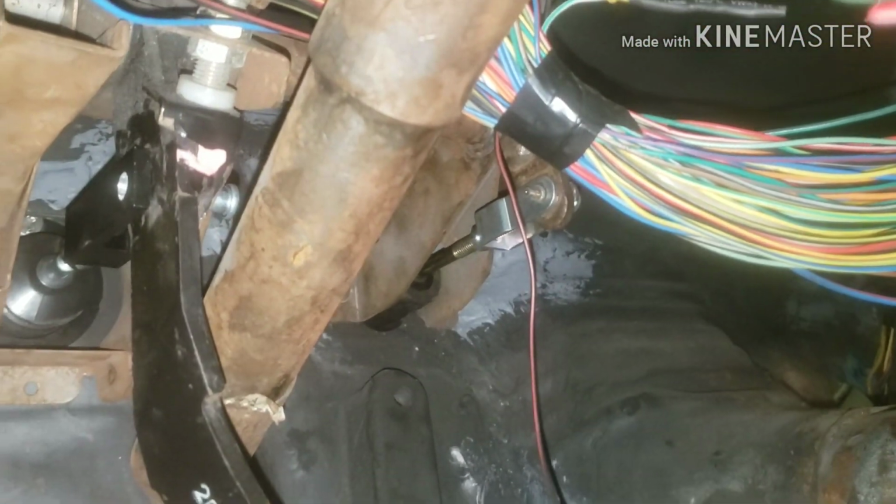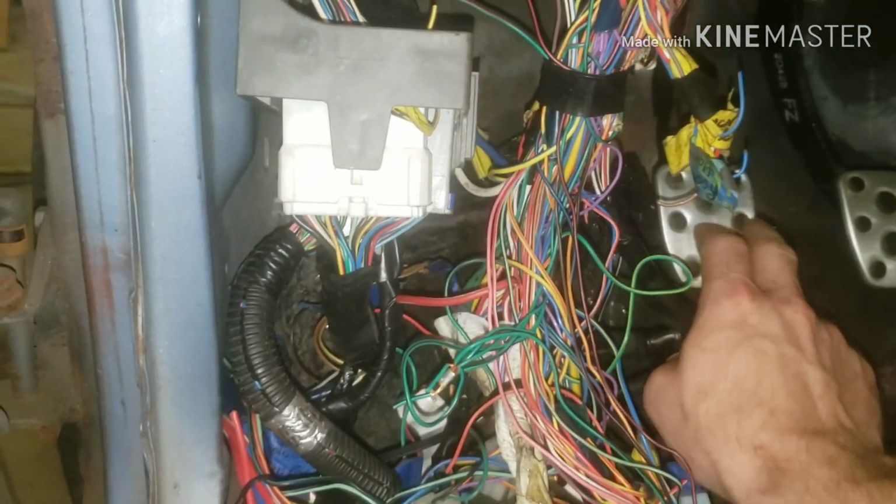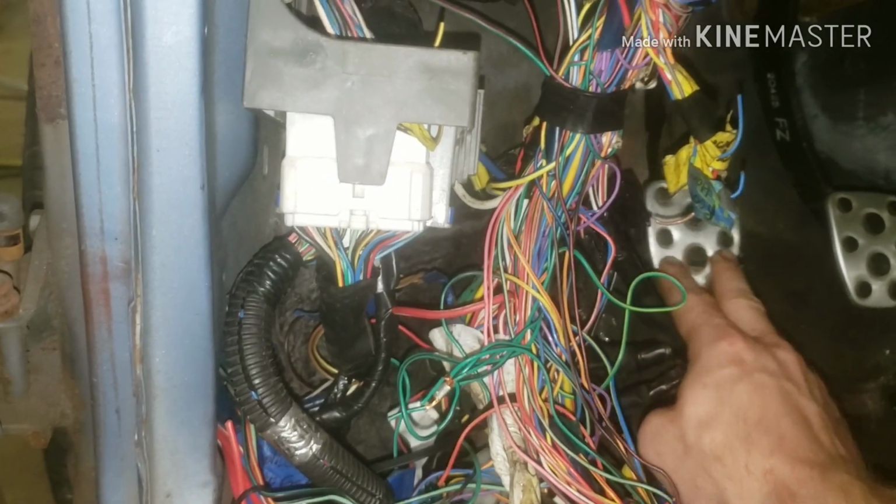When we left yesterday, it was still questionable if it was fully bled out, but I just changed the adjustment on the master cylinder rod a little bit to the pedal rod, and it seems to work good. Sorry, I accidentally ended the video, but yeah, it seems to work good now. It turns all the way on its own. So earlier it was getting caught like right here. It would stop returning that last little bit. I think we're good now.